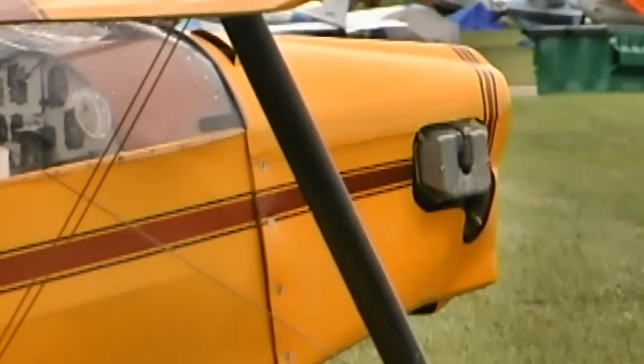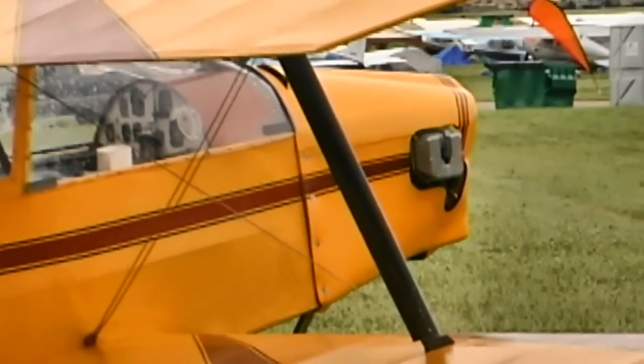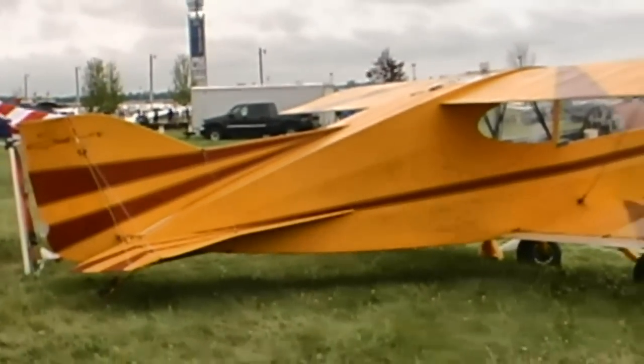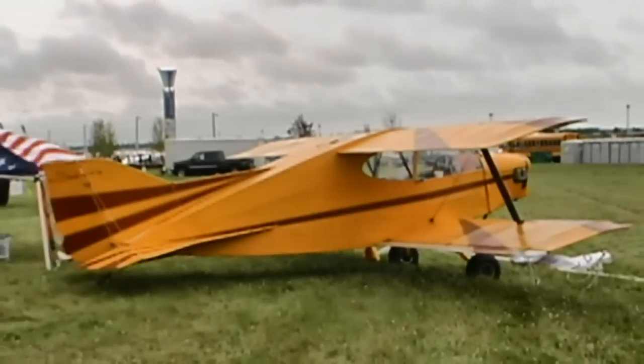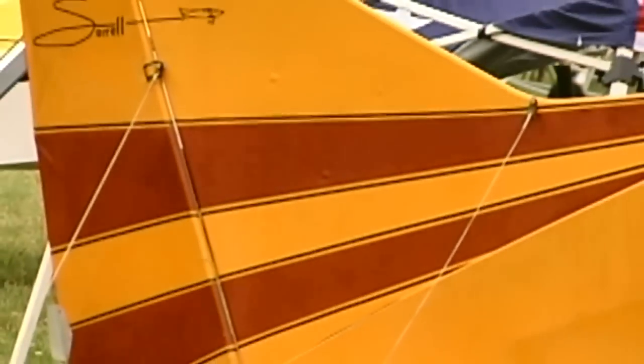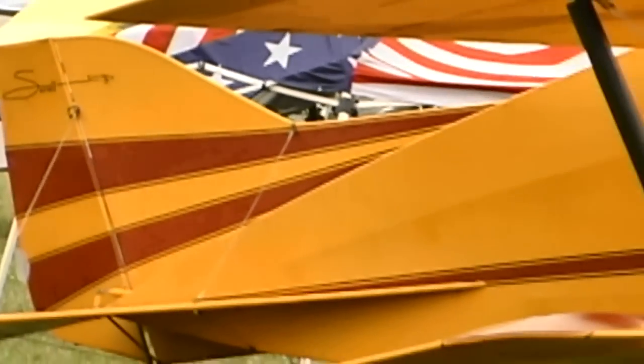We were just discussing your little single-place, but this does not look like a single-place here. No, this is the two-place Hyperlite. Right now it's only available in kit form. Two-place, got a roomy cabin, 42 inches wide. Standard engine is the 582 Rotax, and that'll pull you along at 75 to 80 miles an hour. This one's equipped with the HKS engine — 4-stroke, sips gas at about 2 gallons an hour, about 60 horsepower. Same construction as the ultralight: all steel tube, one-piece fuselage, metal wings, fabric coverage. Total build time on this airplane is about 300 to 350 hours comfortably.